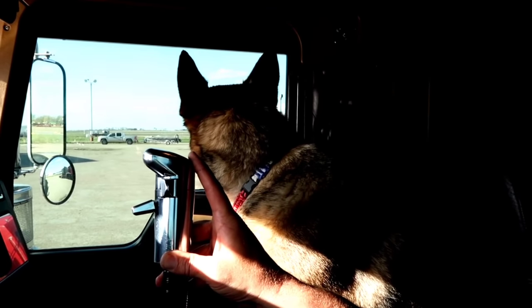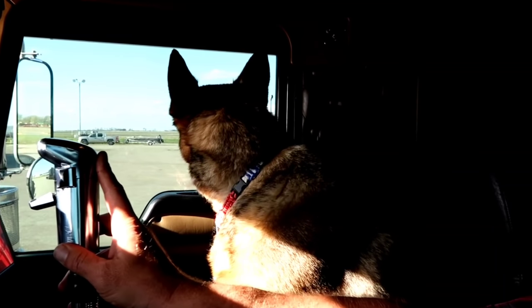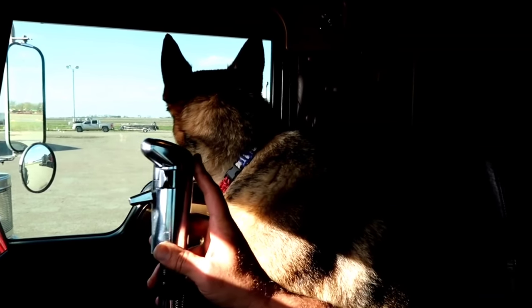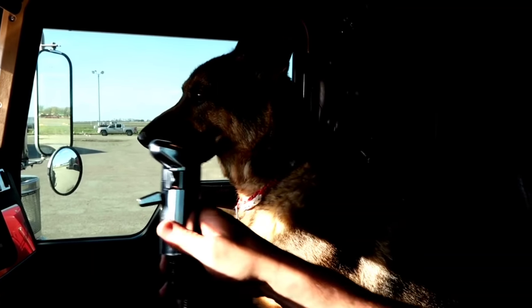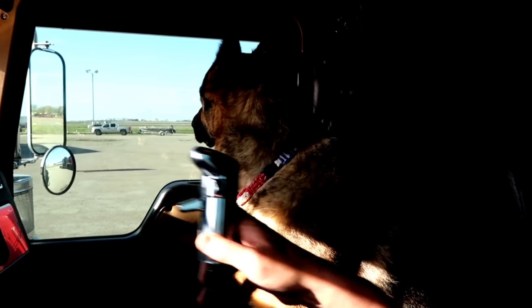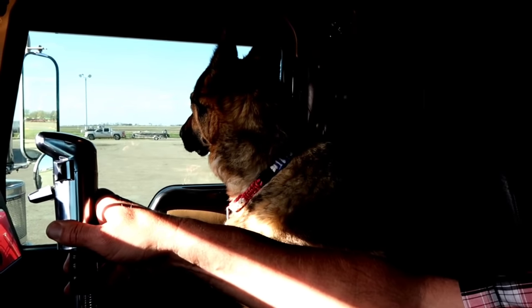What I recognize a lot of guys do is they get about right there, then they slam it in gear, you know, and you hear that right now. You guys can hear it popping, but that's just because I'm shifting the truck and the truck's not moving. But a lot of guys, they get right here, and you can hear it in the background too. If you're listening on some videos, you hear kink, kink, kink in between each gear. You shouldn't hear that. Just nice and smooth.